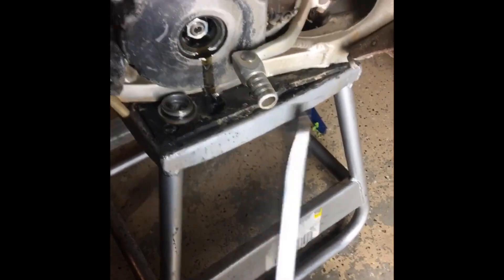To remove the two inspection covers, I just used a pretty big flat-tip screwdriver. Then to remove the valve cover, just remove those two allens — they are a size six Allen wrench — and then remove the spark plug cap, and that will allow your valve cover to come off. Just be careful when removing it that you don't rip your gasket if you want to reuse it. I do not recommend reusing your gasket, but it works for me.